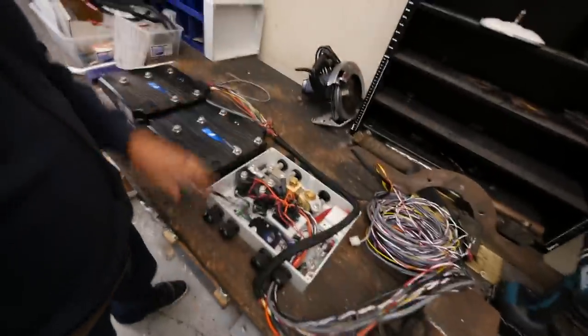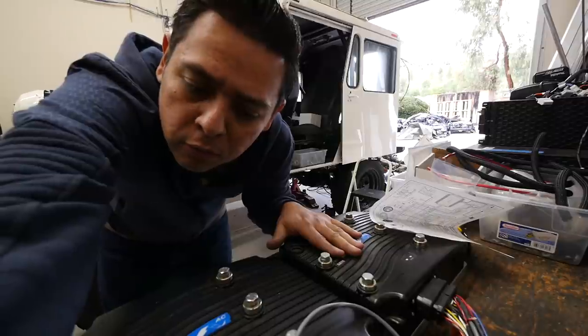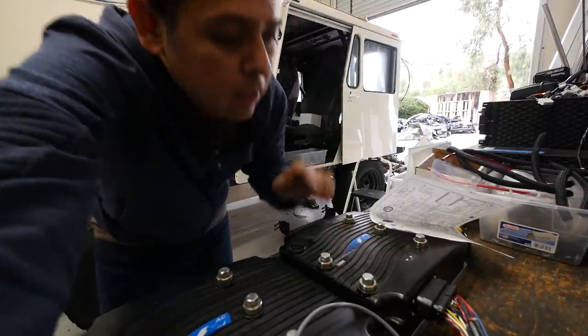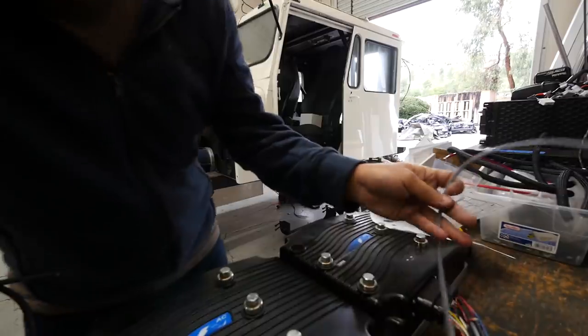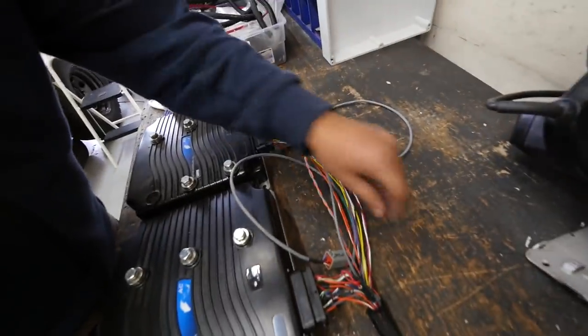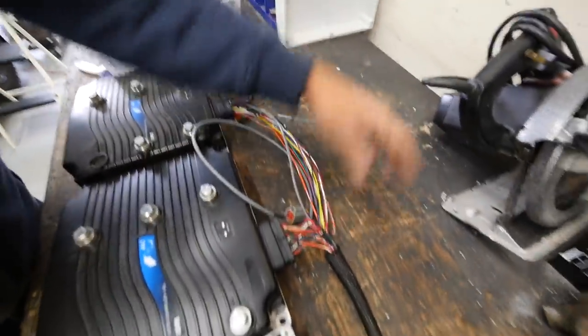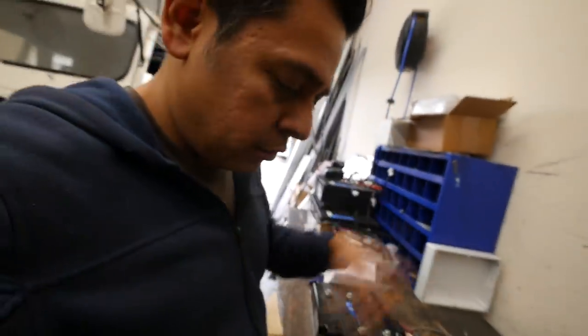This is a first for me because I've never done a dual controller system. So this is a little bit different than what I've done before in one way. These controllers are 1239s, which means they're like higher voltage. So there's a little bit of difference there. Plus I'm also running a master-slave configuration, and so that's what these cables are here. These are the CAN bus connectors, and I kind of modified everything to make it cleaner.